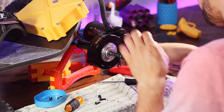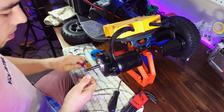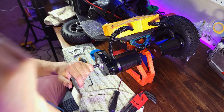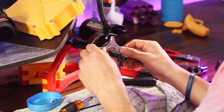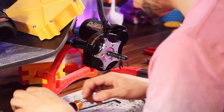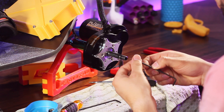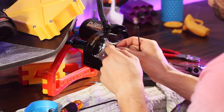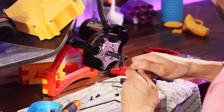Go ahead and get those screws attached. Now is a good time to check that your motor spins freely — you should be able to spin it and it'll have a little bit of free roll. Next, take your star piece and slide it right on, aligning it with the three holes. Take your three countersunk screws and your M2.5 Allen key and slide them in. I'm going to apply a little bit of loctite to these as well — it's probably not necessary but can't really hurt.